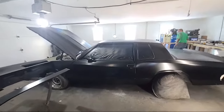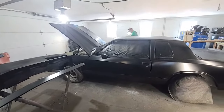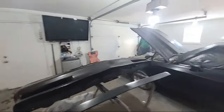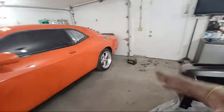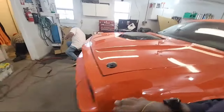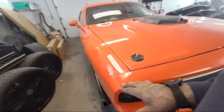And I'm really not worried about the base coat. You can hide anything in your base coat. You can almost put the base coat on with a roller brush if you want to, but it's the clear that I'm worried about with the water and the oil in it, because that's your final stage. So this one, for example, had a lot of little water and oil in it. If I can find some, I'm gonna show you.